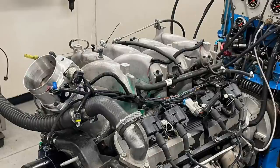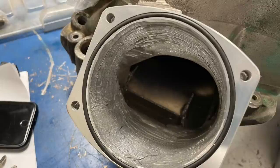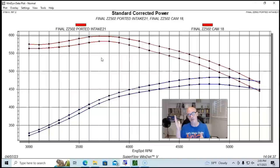When Amos did the manifold, as I mentioned, you got more inlet air going in but the runner length is exactly the same — no porting was done to the runner length, and that is the critical element of intake manifold design, which is why we saw what we saw. A lot of guys will point to the heads holding it back, but I honestly don't think at this power level, given the flow rate of the stock heads, that's the issue. What we need to do now is change the runner length and possibly the flow of those runners to make even more power at a higher engine speed.